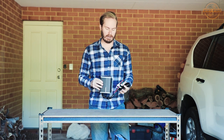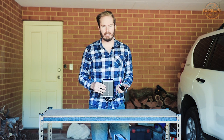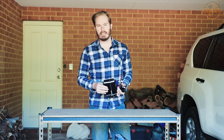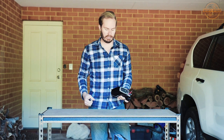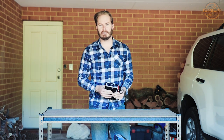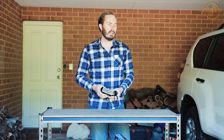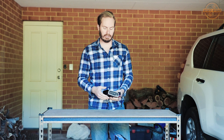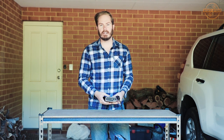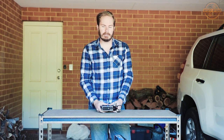I know some of you are going to ask why put this $400 charger under your bonnet when you can put a $100 isolator switch and do the same thing. Well it's not that simple anymore. If you own a GQ Patrol, 80 series, anything older than maybe 2008-2010, you're fine — go ahead and use your isolator. But once you start getting past that, vehicles introduce things like variable voltage alternators and temperature-compensated alternators. They cut down the voltage if your battery doesn't need charge — mostly an emissions thing. That's a problem because it might read that your main battery is fully charged, cuts down that voltage, and doesn't supply enough to charge a second battery. So your second battery is getting maybe 50% charge at best and it'll last a year before it dies from being undercharged. This being a 2014 150 series Prado has one of these special alternators — you need this.